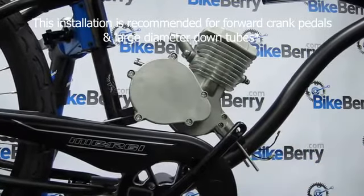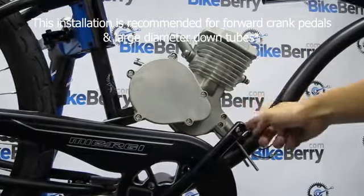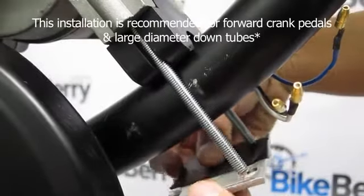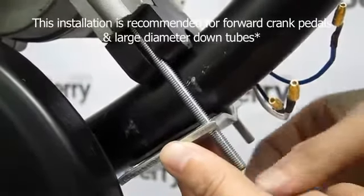For this bike, we are encountering both issues, so to solve it, install the J&M vibration motor mount, position it on the bike the way you want it mounted, and then take the HDU mount, remove one of the 2 U brackets, and install it on the bike like so.